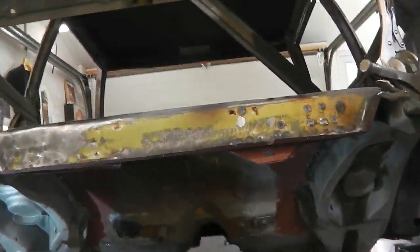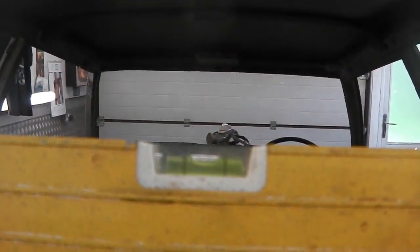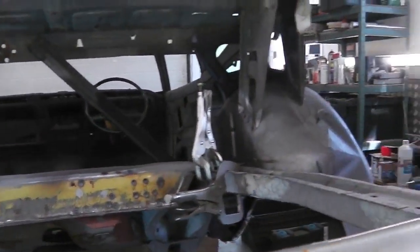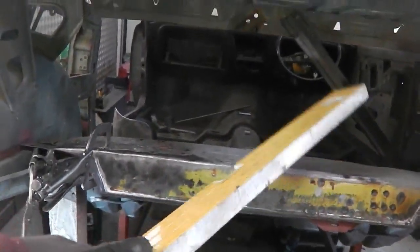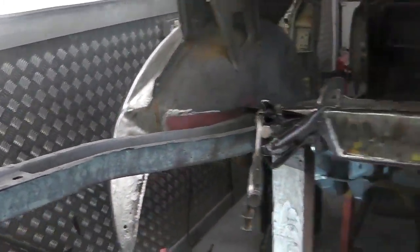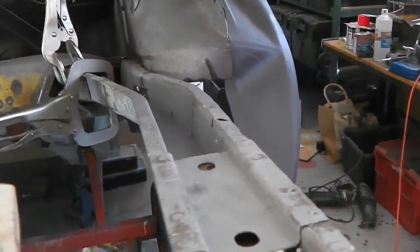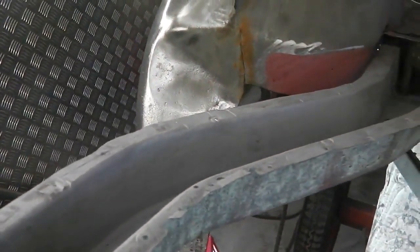Calling them outriggers. Let's have a look at the parcel shelf. I mean, it's a bit late for this now, really. But nope, we're in. So, a complete parallel level line all the way down, including the legs. And in spec on those diagonals, we talked about going this way and going that way. Whilst normally they would be the same to create a square, they're simply not the same because this dogleg's different. In fact, I can see it now, yeah. And I never spotted that before. Look at that. You'd have thought they were both symmetrical chassis legs. They're not, look. There you go. And then look on this side. A big dog leg in it. Wow, I just never knew that.